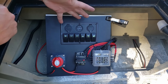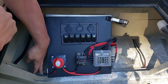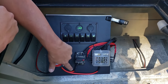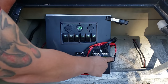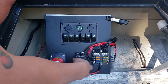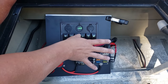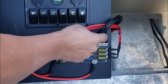Let's try to make some sense out of the spaghetti factory I've got going on over here. Everything is done and wired up — I've just got this panel clipped into place so I can show you all the wiring. This wire right here runs in from the battery and goes into one side of our disconnect. With the disconnect off, there's no power going to anything else in the boat. Once you turn the disconnect on, everything is powered. From the disconnect, we have two power lines coming out: one going to the 60-amp fuse that runs out to the trolling motor wire, and one running into our main fuse panel. From the fuse panel, all of the positive wires are bundled and go to the backside of the panel, attaching to each one of the switches to feed power from the battery to each switch. All the wires on the negative bus bar go around to the back and attach to the ground wire going to each individual accessory — navigation lights, anchor lights, bilge pump, and so on.